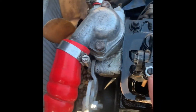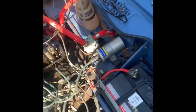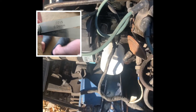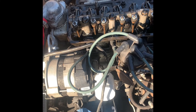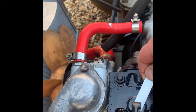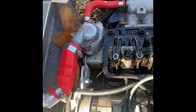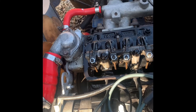All you're going to do is loosen up this bolt slightly and then turn this. First of all, I'm just going to check to see if it needs any alignment. I've put a picture on the top bit there and it says basically zero one zero, and then underneath zero point two five millimetres. I'm just going to give it a little push under that — you should get a little bit of resistance, but not too much. If it is too tight, you'll screw your valves up basically. And if it's too loose, they'll rattle.